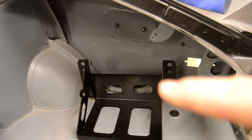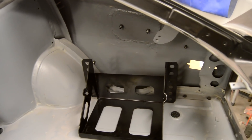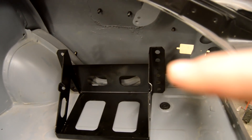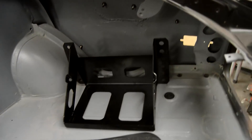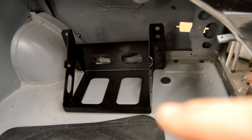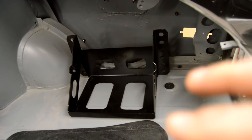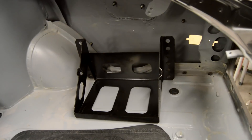You can see how this battery tray was designed to be mounted with these vertical mounting points, but I don't really have anything like that in this area. So I'm going to build an L-bracket that mounts down to the trunk floor here and on the other side, and I'm also going to weld a tab on to the front of it so I can mount this to the trunk floor. I'm going to start making those tabs and brackets.